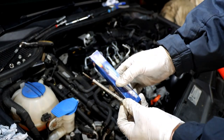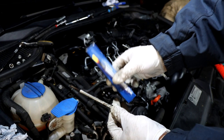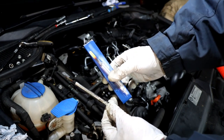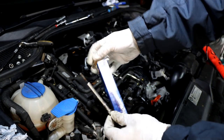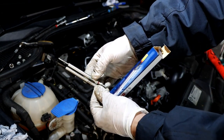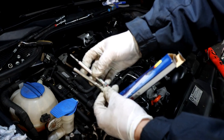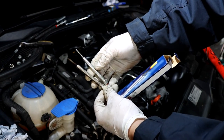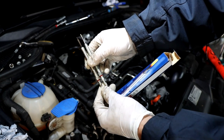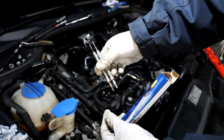Now that you've got one out — obviously when you bought the part, I hope you got the right glow plugs. Once you've taken one out, get a new one from the box and compare: make sure it's the right part, right length — you don't want it too long — and that the thread is the same size. That looks like the right glow plug, so we should be safe to do the other three.